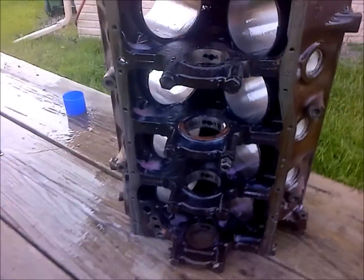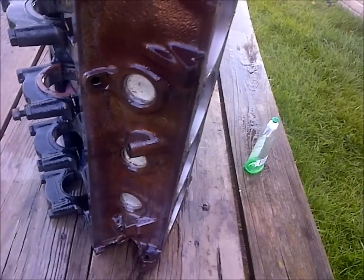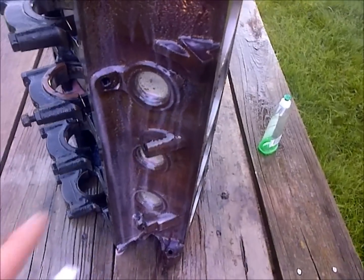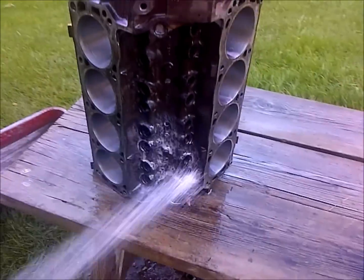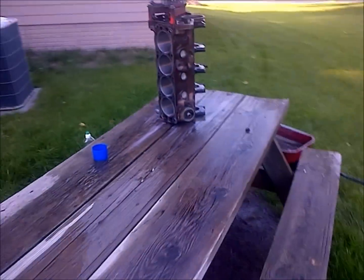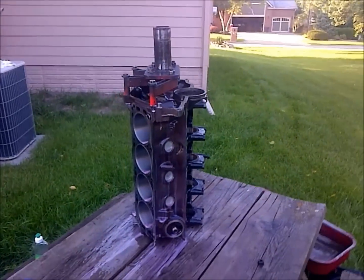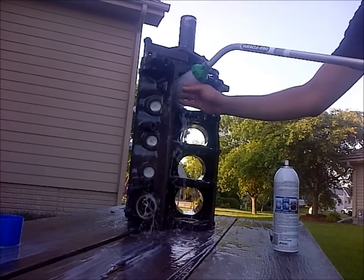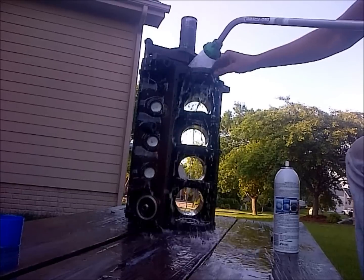That's essential for ring life. Just spray it all in there and rub around everywhere with your hands to get all the grit and garbage out. I already did the outside of the block and got a little bit of oil on it. What you want to do is go around with a wire brush and a screwdriver and really dig all that grit out — it's real important to get all that garbage out, because if you don't, it's not going to paint up very well. This should be about the last round of it, and then we'll wipe it all down. As mama always taught me — wash from the top down.